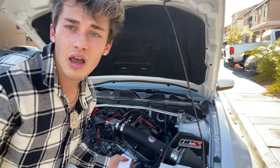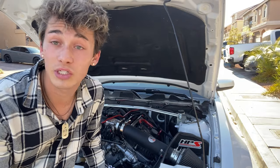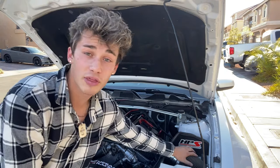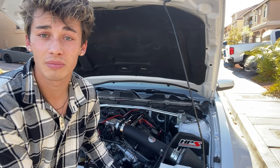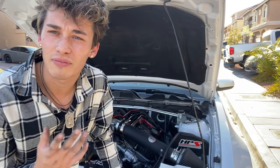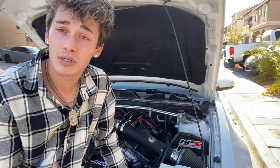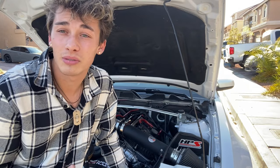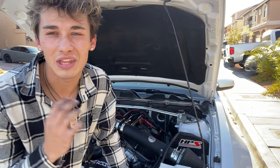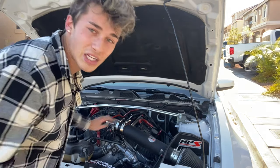You don't need any professionals to do this for you, because this only took me about honestly 20 minutes. Thankfully I didn't run into any issues. The only issue I felt like I ran into was trying to throw this fat humongous filter back onto the car, because since my pipe goes straight forward it goes straight into the fender and I already had about an inch and a half of room as it is. Trying to fit this round filter back into a tight little hole made it really hard. I definitely feel like if anybody's out here trying to do this install, that might be the hardest part. The next hardest thing related to the throttle body spacer was trying to get this last screw in the very back corner.